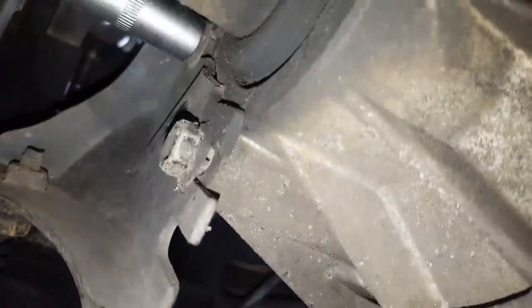Next, I go under the car and I'll remove this. As you can see, it's 13mm. These three bolts hold the catalyzer in place for the exhaust system. Anyway, I'm not going to show you how I remove this, just three bolts, not too hard to open. So, after you remove this little metal piece, next I'll remove this bolt for this axle eye. And behind there, two more bolts.